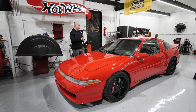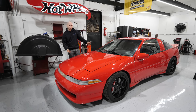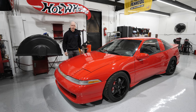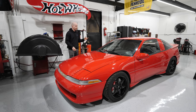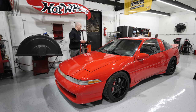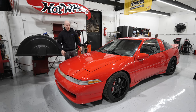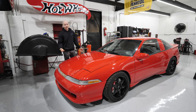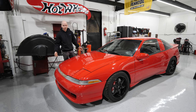I'm not going to do it half-packed. I want it to feel like it came from the factory with the engine back there — an awesome street car that's comfortable. I've got a full new interior for it, a new sound system. The engine has some problems, so we're going to rebuild the 4G63 from the block up. The transmission has an open differential, which is fine when it's front-wheel drive, but once it's rear-wheel drive — no.